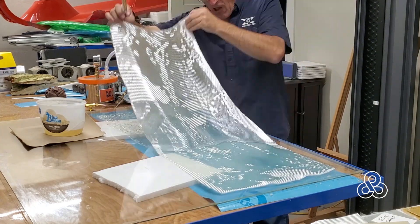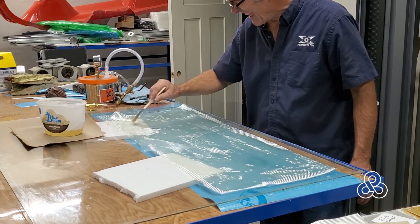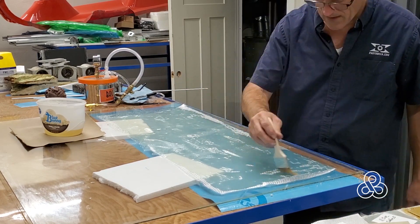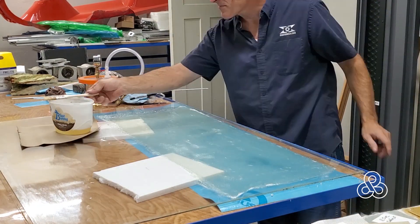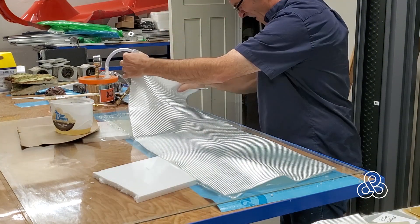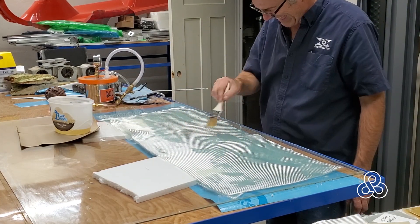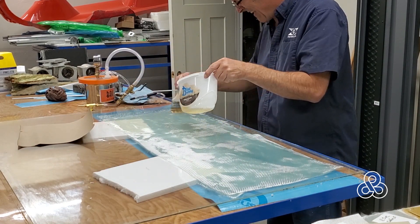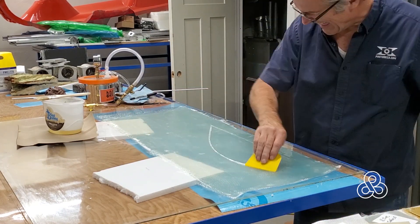To make the main form of the wheel well, we're just going to lay up some flat panels. I have a piece of glass with some releasing agent on it and I'm going to lay down about four layers of fiberglass. Put some fiberglass down, saturate it, get the resin in there — maybe a little rich — then go back with the squeegee to remove excess resin. The weight comes from the resin itself, so keeping that ratio good keeps it as lightweight as possible.